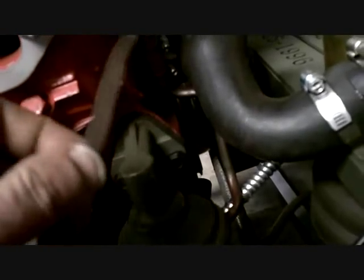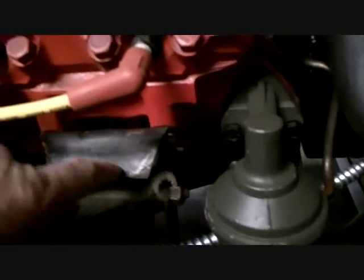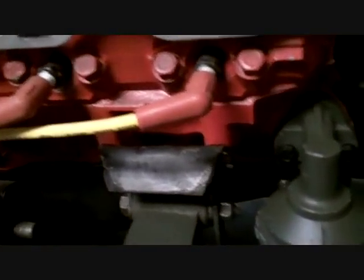But if I start it without exhaust, it's going to be really, really loud. I'm also going to put my ground fuse clamp on. I'm thinking probably off of a transmission mount and somewhere where there's a frame connection — something heavy. Maybe the bolt for the motor mount. Now that bolt's going to steel. There's rubber between this pad and this bolt, so that's the connection I have to make.